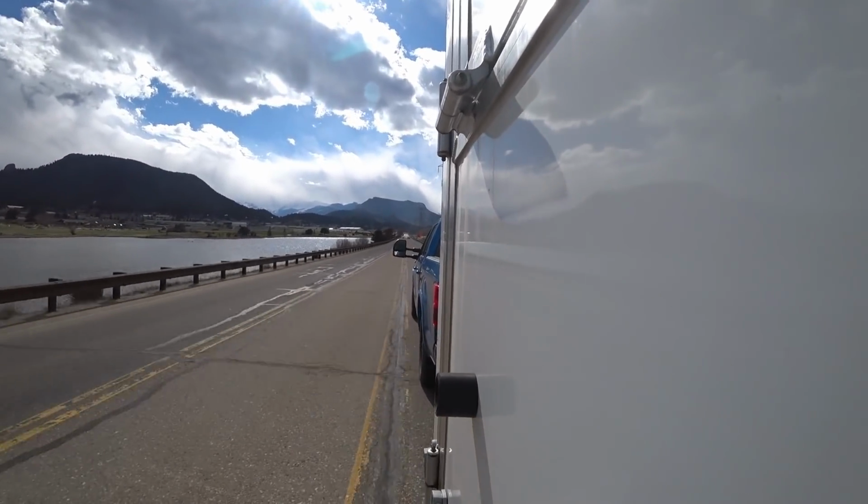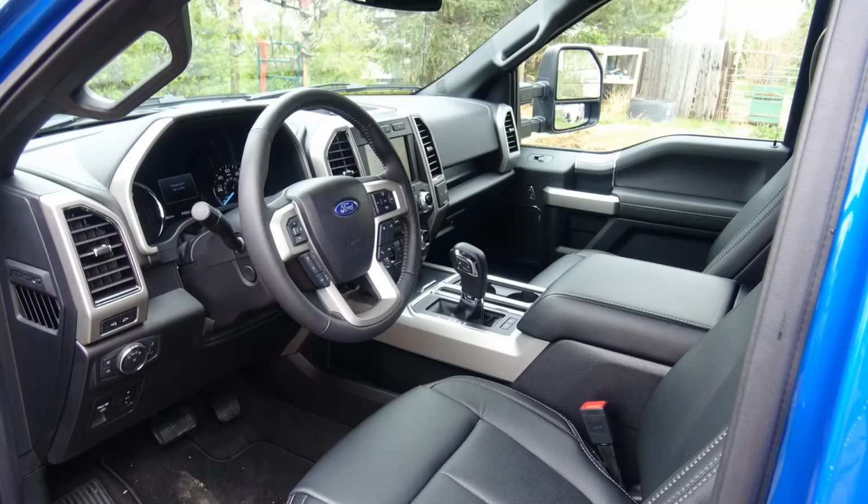Yeah, I think if you did have a 3.73, it would purr a little. It would get up and go faster. You're right. That's a fuel mileage rear end, but that's what they're trying to do, let people see both ways. And if you were to get something close to a 12,000 pound trailer, you would want the 3.73. Oh, yeah. But maintaining or accelerating speed after you're already going, it's not a problem. It's getting going. Yeah. It feels like there's a pull to go.